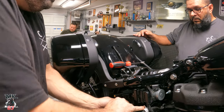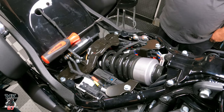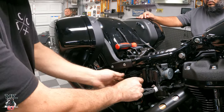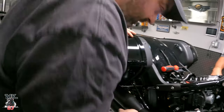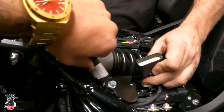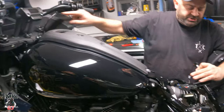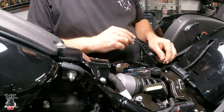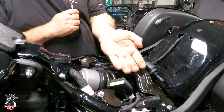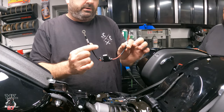So where's this famous plug? It's near where the battery is. We've got to actually separate this and get into the front side of that plug to pull that pin out. We do have to pull the battery because the positive terminal goes down to the battery screw, so we need to install that too. This connector is your main backbone connector — it runs up the backbone into where we put the pin for injection. We're going to take this wire and put it into the back of this connector to feed power up. I'm going into pin nine, and this will go to the battery — this is your main power for your amplifier.